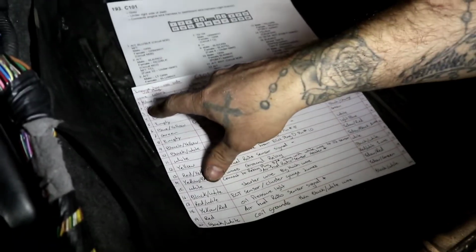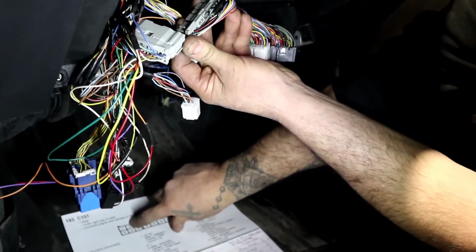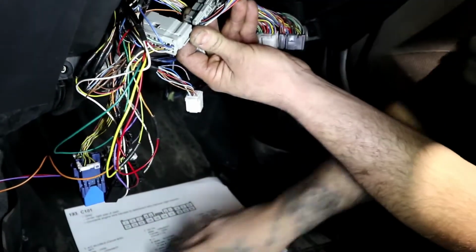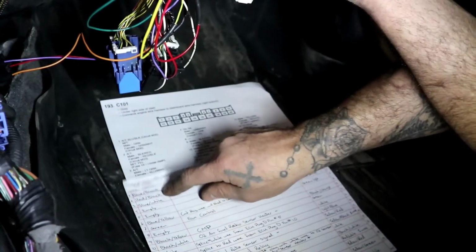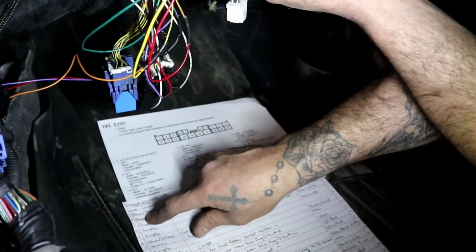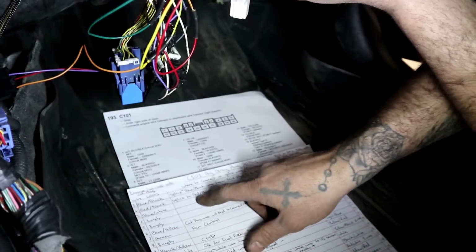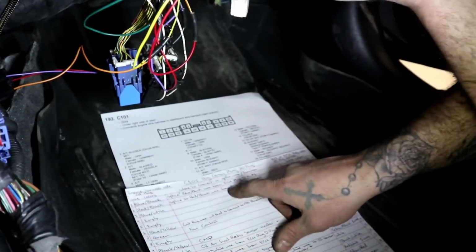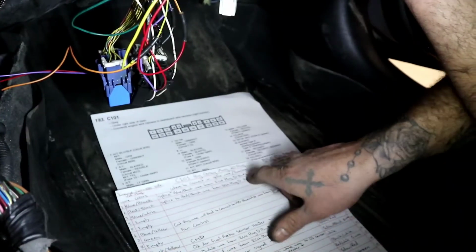Awesome. Okay, so number 2, next to number 1. Guys, pay attention to the wiring colors, because the wiring colors will change on us, so don't get cocky. Look, number 2 here, we have a red with a black stripe. Splice that red with the black stripe wire from ECU plug D, number 4. That's the engine harness side.